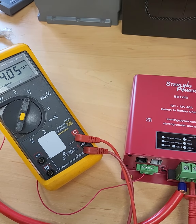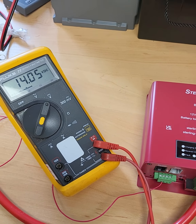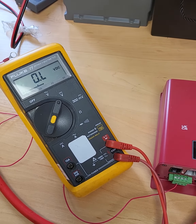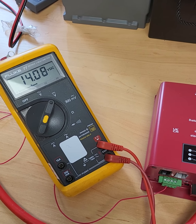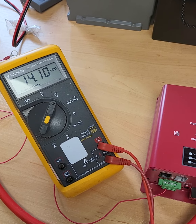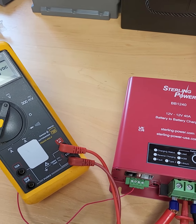Normally there's about a two-minute timer before the battery-to-battery charger turns off in one direction for it to activate and go into the reverse-charging direction. So I'm going to pause the video and resume it in about 60 seconds, because that's when it will have kicked in.